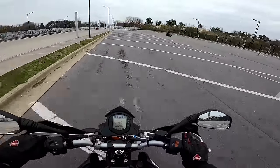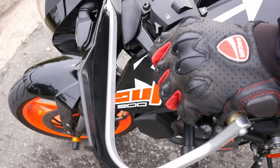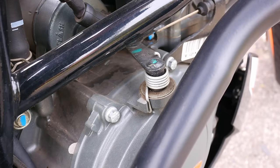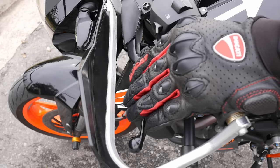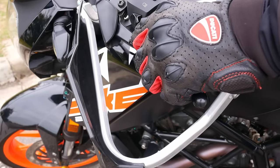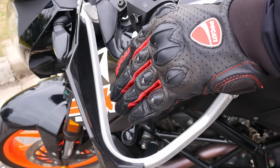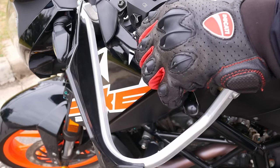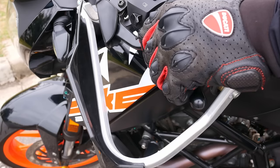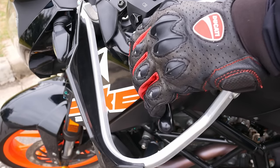When we release the clutch, our engine becomes rigidly connected to the gearbox, and our bike directly starts to respond to the throttle. When the clutch is pulled in, the engine is disconnected from the gearbox — this is called a disengaged clutch. When the clutch is released, the engine is connected — this is called an engaged clutch. There is a whole range between engaged and disengaged; it is not just an on-off switch. All this clutch lever travel has important points and zones to it.